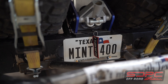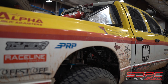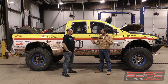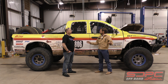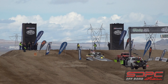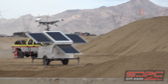It took a year of solid labor to get everything back together with some trial and error. For the most part, everything slid into place as far as the chassis was concerned, but driveshaft lengths had to change because I swapped rear axles and transmissions. The motor dropped right in, and once we got it all wired up it fired and ran right off the bat and drove around the block with no problem. We hit the Mint 400 in March of this year with a goal to add about two miles per hour to our overall lap speed and see a hundred miles an hour across the dirt.